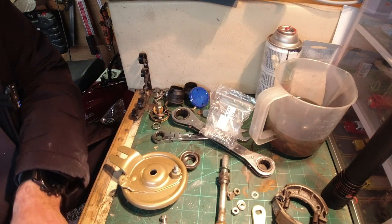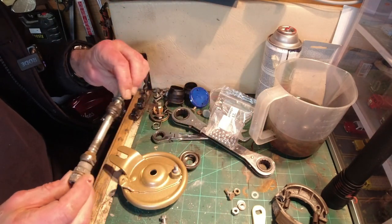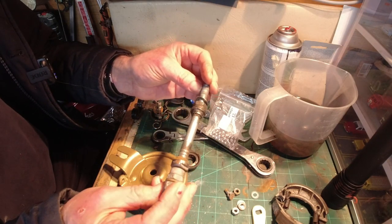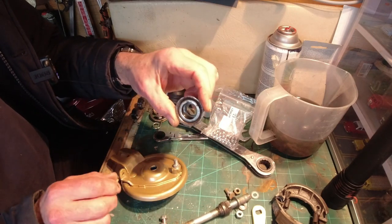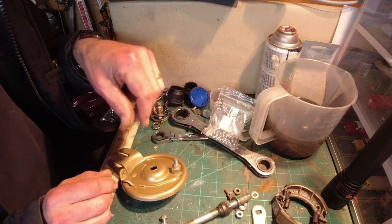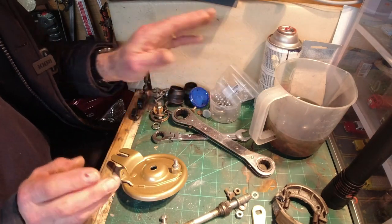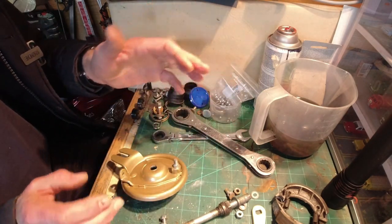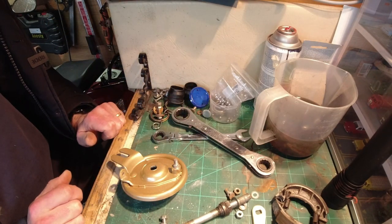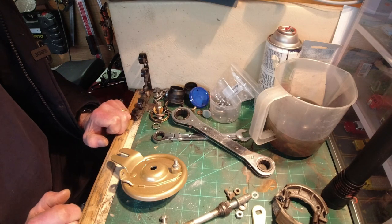I'm trying to build up all the front side of things first - just little bits and pieces. I'll leave this for today, then tomorrow come back and sort this axle out. I've cleaned up the old rusty bearing race and it's all shiny in there now, and I've got a couple of sets of ball bearings. So hopefully tomorrow we can clean this axle up, get the brakes back in, and get the axle back onto the wheel.